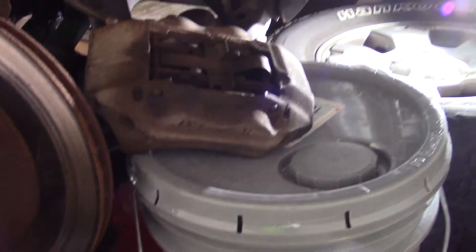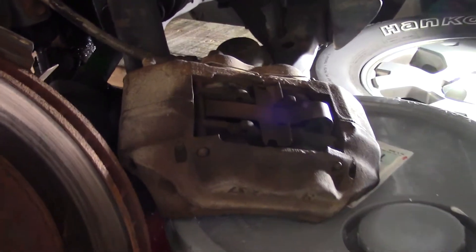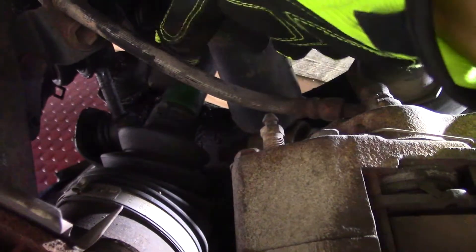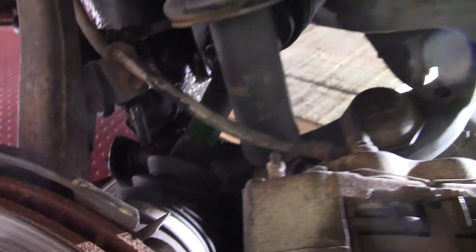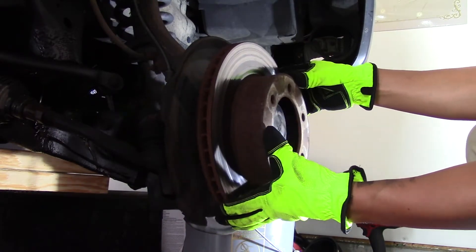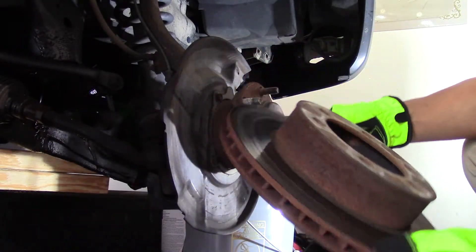There's a little slippage but it's okay — there's no tension or force on that line. Now I have a nice safe place to work on the caliper and remove the brakes without any tension on the line. Here's a close-up: you can see the line still has some slack in it, it's not taut. That way you don't have to worry about breaking the line and causing additional work. Removing the old rotor is very simple — there are no mounting screws like some vehicles; it just slides right off the hub and knuckle assembly.